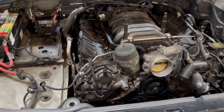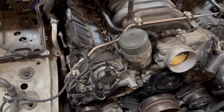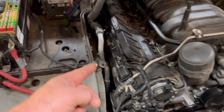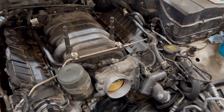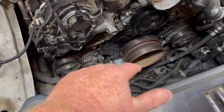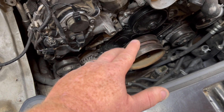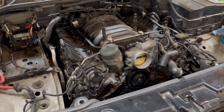We're back down in the shop working on Kaya's LR4. Last night we only got an hour to spend on it. We did finish putting the top cover on and the valve cover - that's all torqued down and cleaned. We installed the injectors, the fuel rail, ignition coils, and then reconnected the wiring harness and the fuel crossover tube. We're ready to start putting this front end together - first thing we're going to put the lock on the dampener pulley so we can torque it down, then put the starter back in and build up this front end and see if we can get it running.